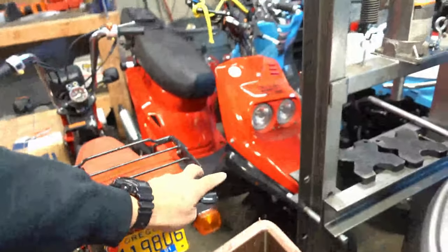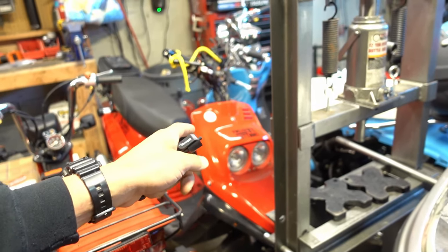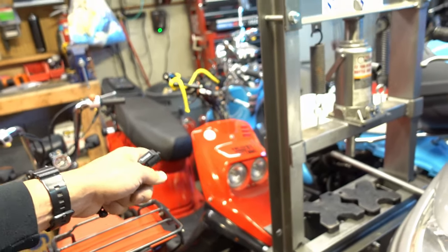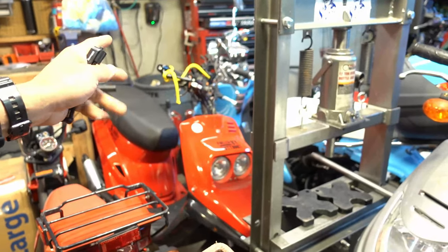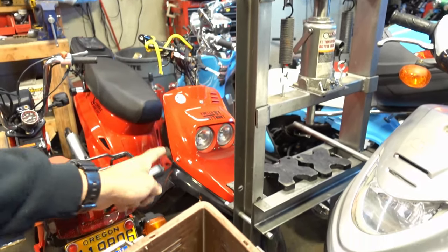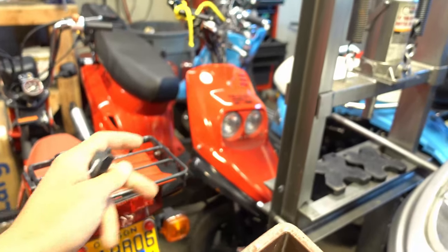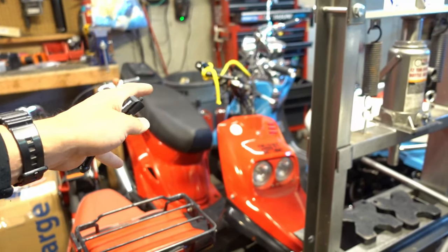This is my favorite — you guys know what these are. That's a 49cc two-stroke vertical Minarelli. That's my favorite. Those were made from '89 to '01. That is a two-stroke vertical motor, carbureted. Some of the older ones came with drum brakes; this one came with discs. They had a couple different styles — it came with different fairings and different colors. This one has naked bars. I've got tons of videos on that bike, but these are great.